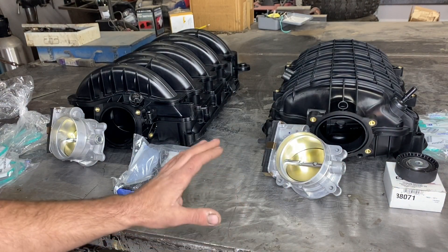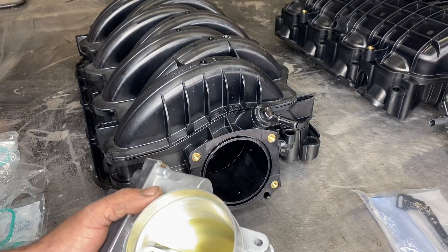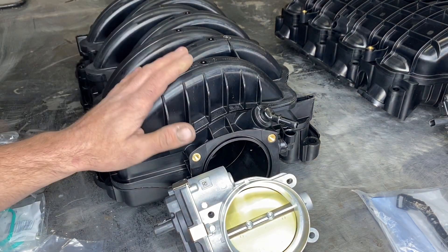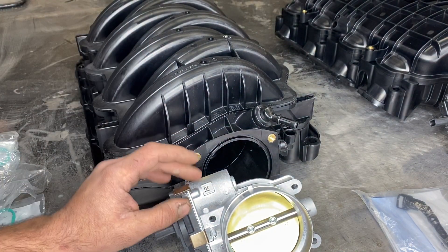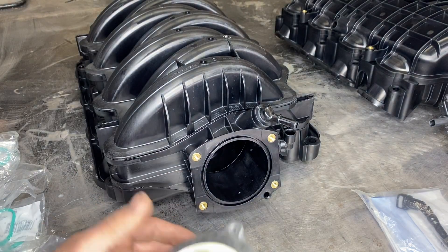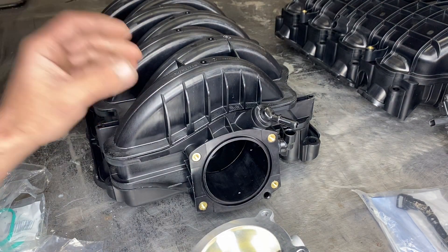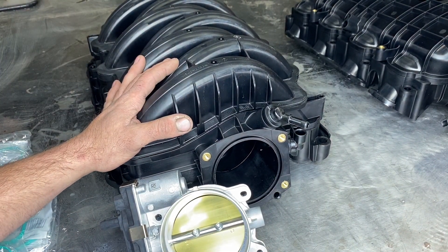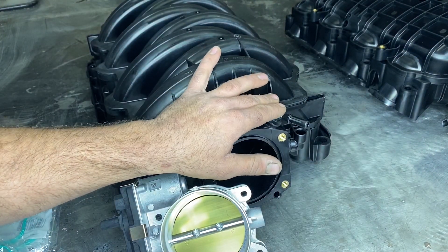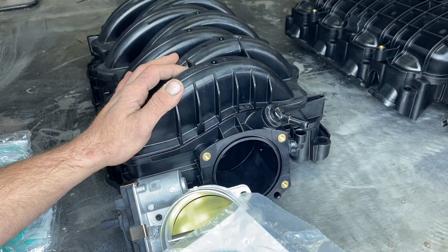First, let's go over the L86. Here we have the L86 intake manifold and throttle body assembly - it's a great improvement for you guys with the 5.3 liter, with much better throttle response and overall engine power. Unfortunately, you cannot swap the 5.3 liter throttle body onto the 6.2 - you can't reuse it. The bolt pattern is different. The throttle body on the 6.2 is 87 millimeters versus 80 millimeters on the 5.3. As far as fitment, everything bolts on and fits great. The only thing to worry about is the PCV line is in a slightly different position on the 6.2, so you can purchase the 6.2 liter PCV line. You will also need the throttle body gasket from a 6.2 liter.